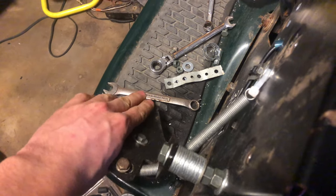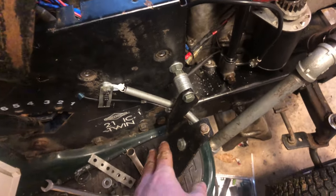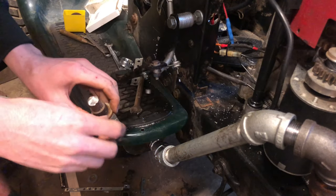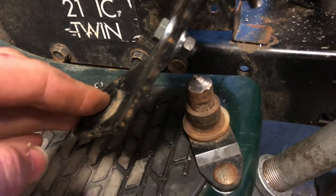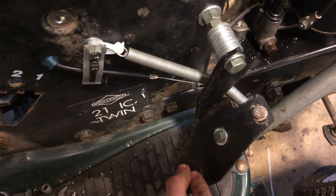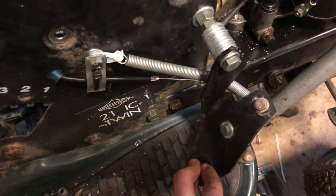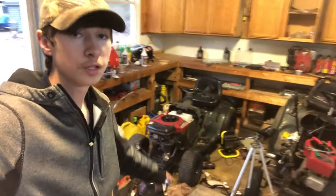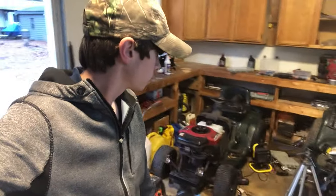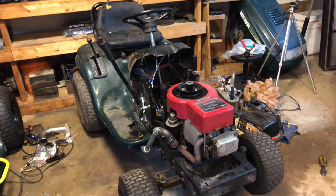I'm going to see how that is and if I don't like it, I will hook the governor back up and tune it. I think the throttle on this thing is fine for now because it took a lot of fabrication and frustration. I'm going to add this little piece right here - boom, cut it on there, have it adjusted perfectly to where it pulls the maximum amount and not try to pull any further. It's a little bit short throttle distance for my liking but we'll see. Everything is pretty much good to go. I'm going to real quick swap the tires from the racing mower because these tires won't fit - we're gonna make them fit in the next video. Bam, just like that, they're swapped.